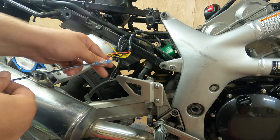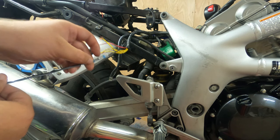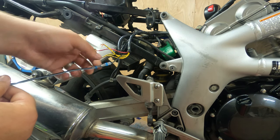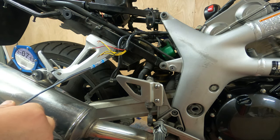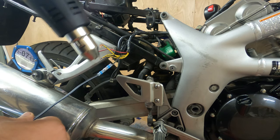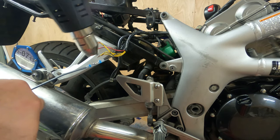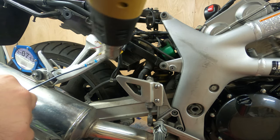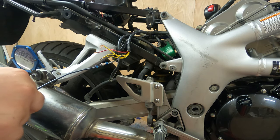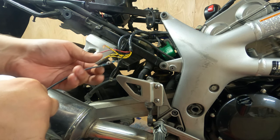What you want is your cables spliced, with the sleeve over the connection — the solder in the centre is over the two exposed wires that you've just linked together. Then just get your heat gun, get it hot but don't melt the cable. As you're doing this, just keep it moving — and that will leave you with a good solid connection.